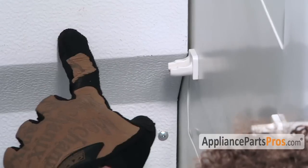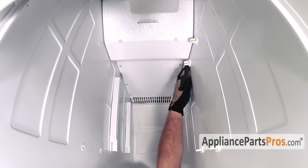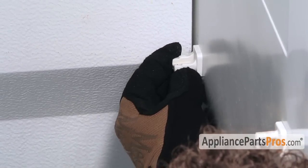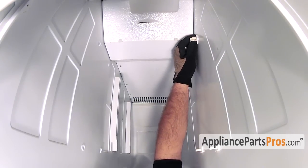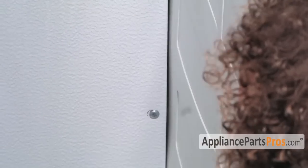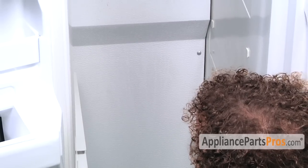Also to make it easier to get the back panel out, we can take these mounting clips off. They should just pop off if you push up on the bottom of them. Not all types release like this, so make sure you don't force it and break it — they should just slide up fairly easy. Do this to all four of them. If you have the style that doesn't come out, you may have to just work around it and twist the back cover as you pull it out.